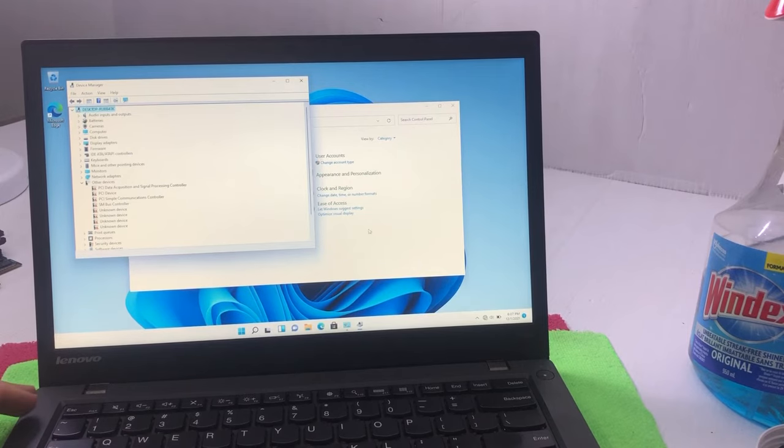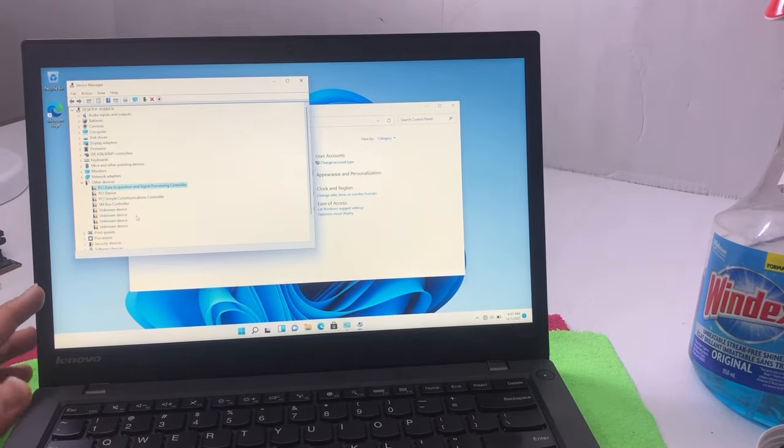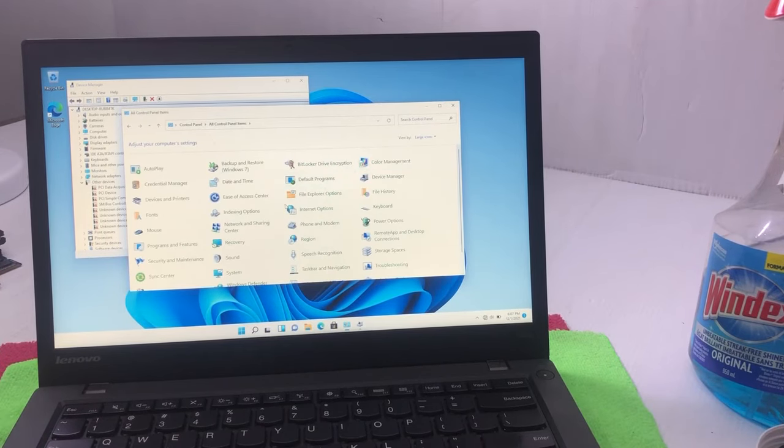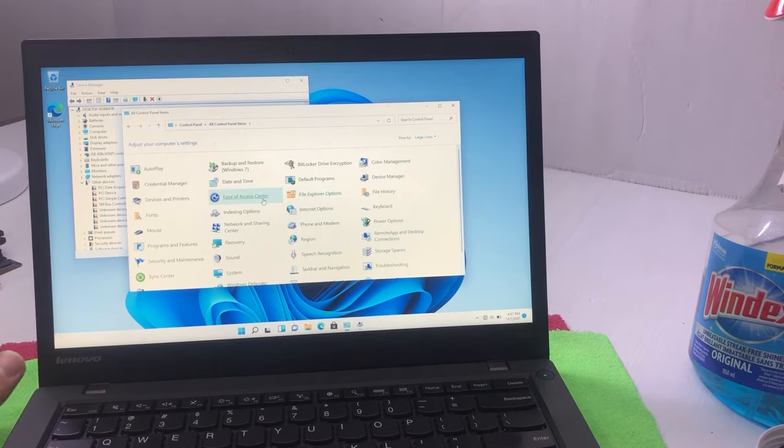You can connect to the internet and then update all these drivers manually, using update driver. It will install the drivers, and after all of them are done, you have to restart your computer. But there is also an easier way to do it automatically, for all of them, including those updates which you don't see in here but which are required for the laptop to be updated.